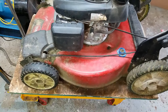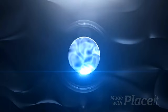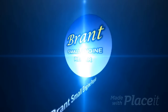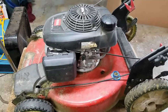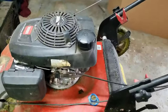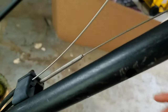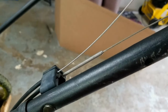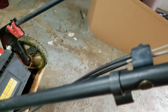Let's take a look and see if we can figure it out. When you have a mower where the self-propel does not work, the first place I'm going to look is typically the cable — especially if your mower is being left outside — because a lot of times these cables will get water down inside the sheathing, start to rust, get really stiff to pull, and then the cable can snap on the inside as tension builds up.